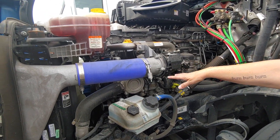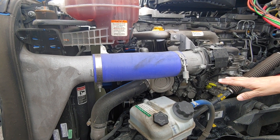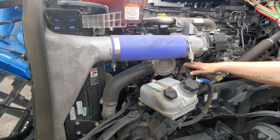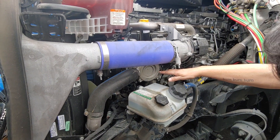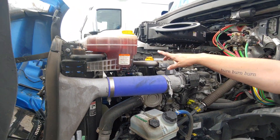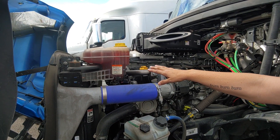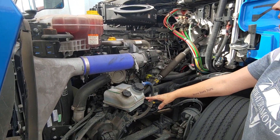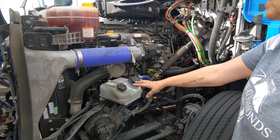And we're gonna come to the belt-driven water pump. Properly mounted and secured, not cracked or broken, not leaking. The belt is not frayed or worn, and it has a free play of between half inch and three-quarters of an inch. Then we're gonna go to the coolant — not cracked or broken, properly mounted and secured, not leaking, filled to manufacturer's specifications. Now we're gonna go down to the power steering fluid — properly mounted and secured, not cracked or broken, filled to manufacturer's specifications, and not leaking.